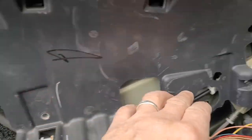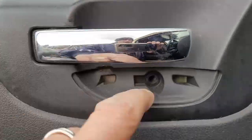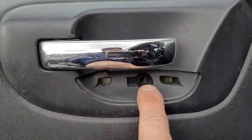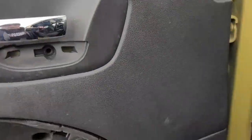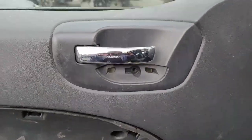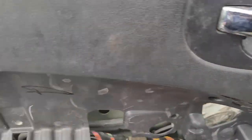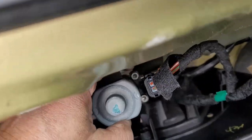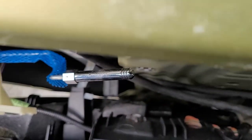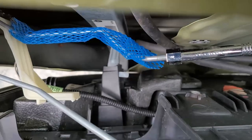You've got this little panel behind here. Undo that screw and play with it - you should be able to get it to let go. That long screw right here. Lift it up, drop it back, and now this is your door window motor right here. And then another part of your door track.